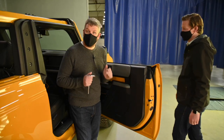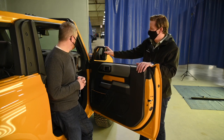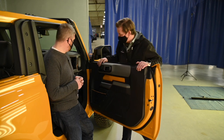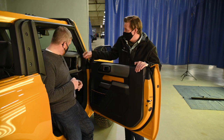Now it is time for the passenger door to come off. We're going to start by getting the mirror out of the way — it's going to swivel right here, which makes it a bit easier to pull the door off. Then the next step is to disconnect the electrical, which is plugged right here in the middle — we'll pull that out.